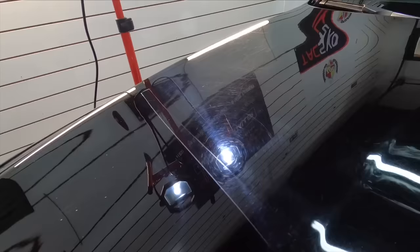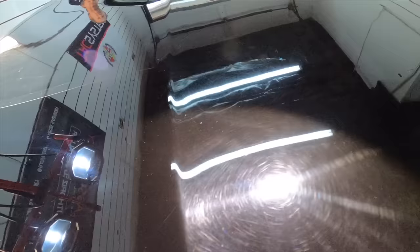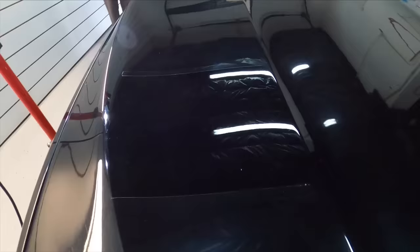This is a fantastic turnaround. If I need to, I can make another pass. If you're wondering why it looks so nice and clear — it does need to be finished down and there is a little bit of hazing there. But if you were on softer clear coat, there would be a lot more haze with something this gritty used to cut. Using my correction light here from Eastwood — I'll try to remember to put a link below — as you can see we have nice turnaround just from the cutting portion. Wait till we grab the Ice and finish it down — this color will look fantastic.